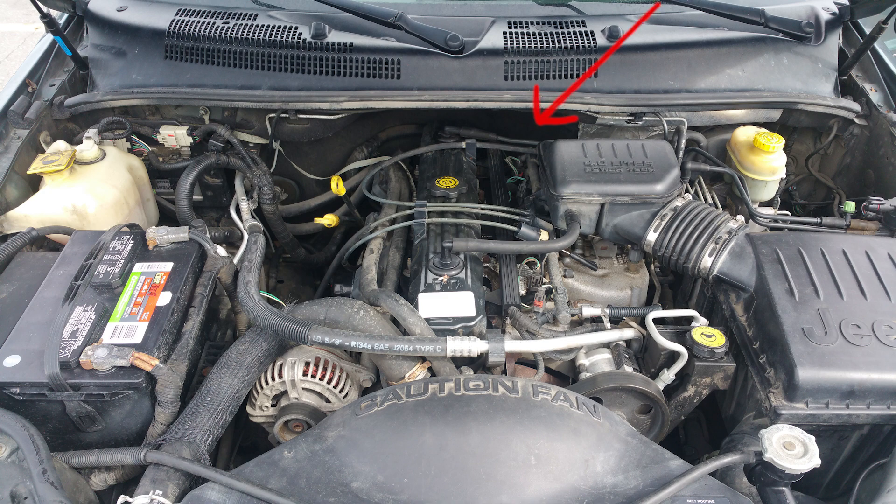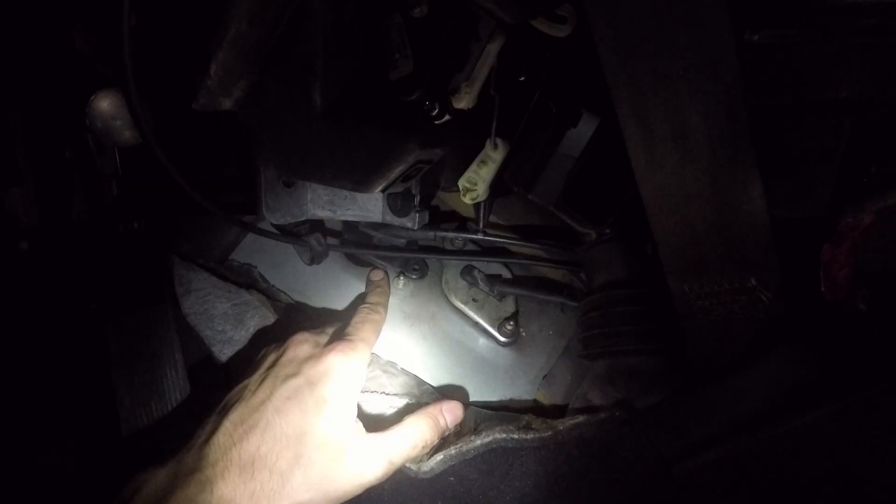I also put the new sensor back through the top. After tightening the bolt from inside, I installed all the interior panels in reverse of how they were taken out. So there you go — the simpler way of replacing the crank position sensor in a Jeep WJ. I hope this video is helpful. As always, thank you for watching, and if you haven't subscribed to the channel please take a moment and do so.